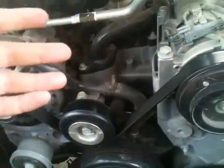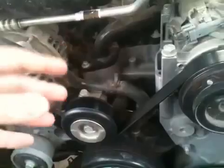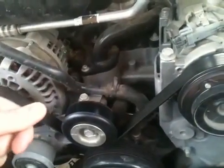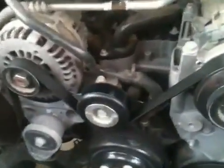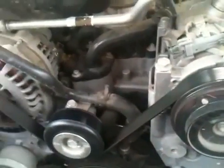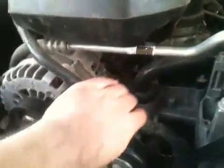The engine is actually too cool. And in fact, if you've thrown this code and you stop your car, let it cool overnight, and come back the next day, the first thing that happens when you turn your truck on is it says 'engine hot AC off.' Obviously the engine's not hot — you can put your hand on it and grab every hose and surface. Everything's cold. It's a false code being thrown because of the thermostat issue.